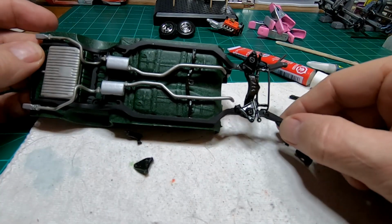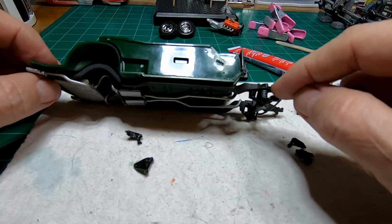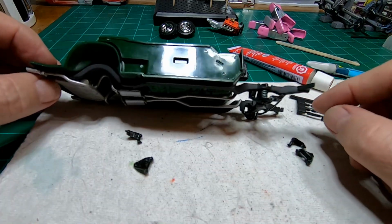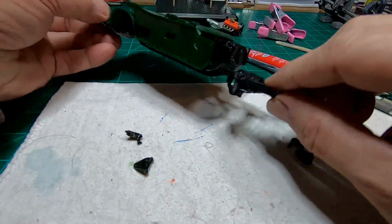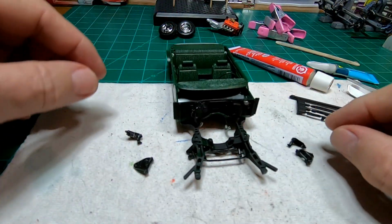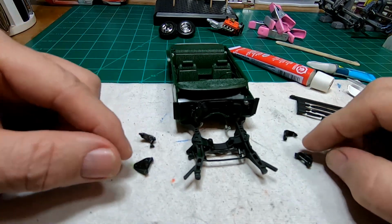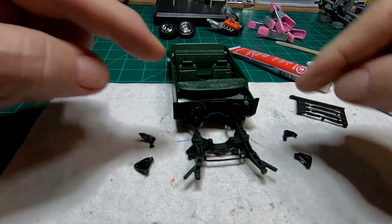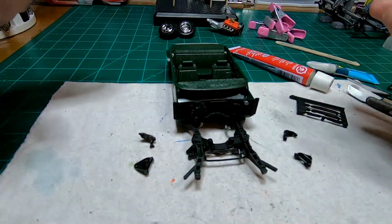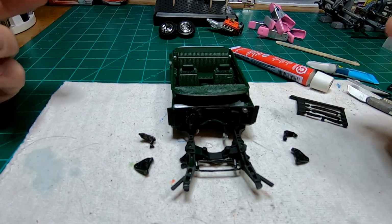This front suspension goes in, the bottom part goes in pretty easily. Don't forget to put your springs in though. Can you guess what I did? So anyway, don't mix up your spindles or your upper control arms, because they will cross and they will fit together either way. But there's an easy way to figure it out.